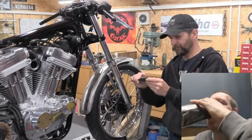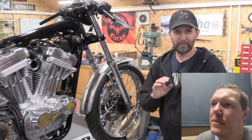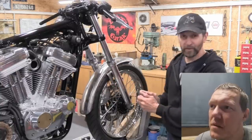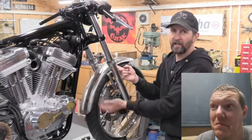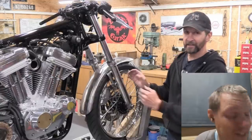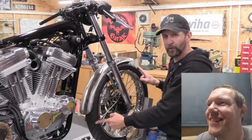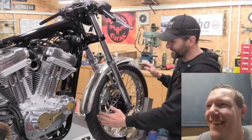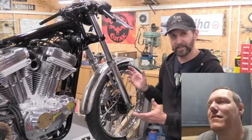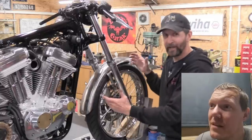25.3mm - I've got one inch slammed out of that bracket, and it looks lovely and snug down on the tire. There's a good inch of clearance in there, enough for debris to get out the way, and it looks fantastic. But what it has done unfortunately is expose the slight difference in radius between the mudguard and the curve of the low-profile tire - it doesn't look perfect, like it doesn't exactly fit. It's a compound curve.